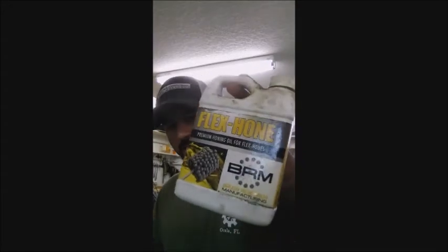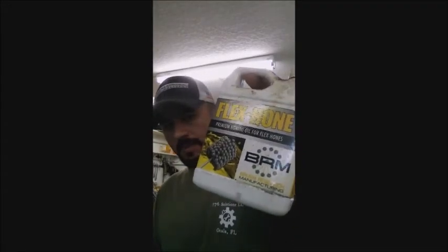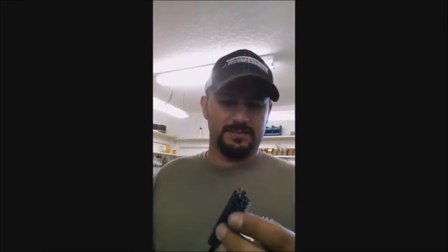Before we do that, you need to use this flex hone oil by BRM. That's who manufactures the hones. I've never really used anything outside of BRM because they say to use it with their hones. That way you protect the finish and the abrasive properties of the hones. But you just simply run these back and forth in the bore with this oil on it, and it polishes it up pretty dang nice. So we're going to go ahead and take a look at that and see what it looks like.